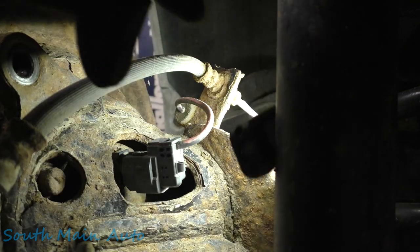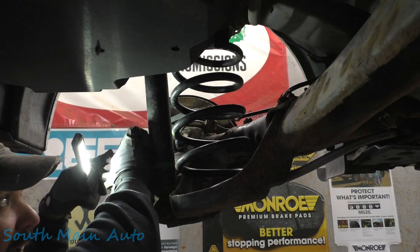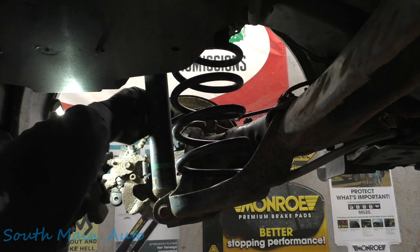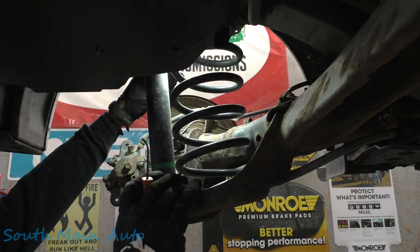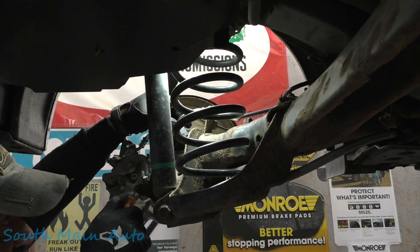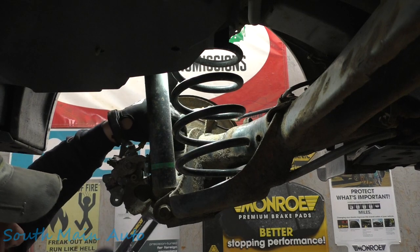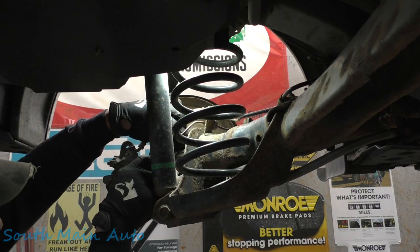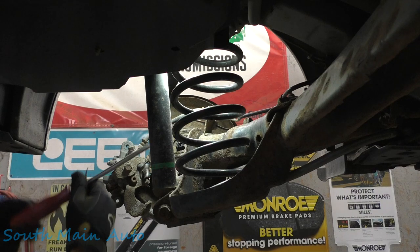You know me and my big nose, I can usually smell a broken wire. I just gotta figure out how to get the connector undone here. Thought these were the connectors I've seen break before, but perhaps not. Let's open that up. I thought it was these Toyotas I've done some of where they break right here at the connector. I mean, like at the last inch, or the last quarter inch usually. I thought I'd seen it. Okay, so that's just a protective little case that goes over. Oh, you guys can't see crap, that's good. But we need to unplug it anyway, so let's get it unplugged, perhaps. Maybe. Let me get another screwdriver up here, see if I can hit the release tab on it, and then.